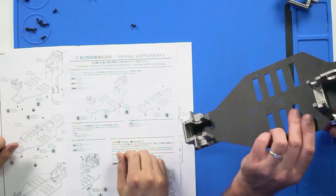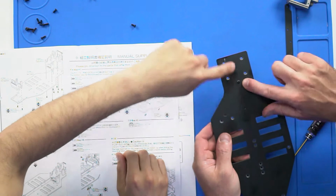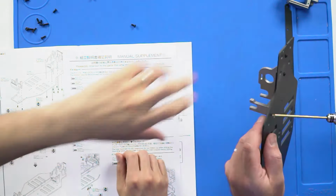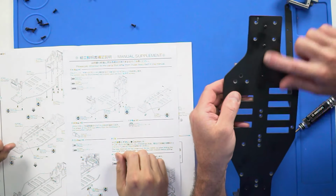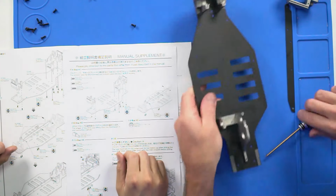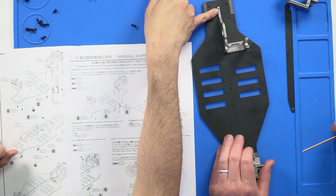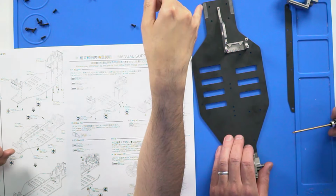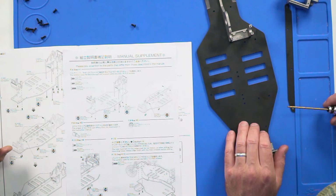Yeah, but it's the whole motor mount. Yeah, that's countersunk, isn't it? Yeah. So once we unscrew those, this will hold it in place. Yeah, but I'm just saying at final assembly. Yes. If these go through the... You definitely want to Loctite that, because you can't do that up tight on the polycarbonate. In the past, the original one only had the back screw holding on the under tray. Oh. But it looks like they've put more screws in there. Beefed up the under tray. Yeah. Nobody wants a flapping under tray.